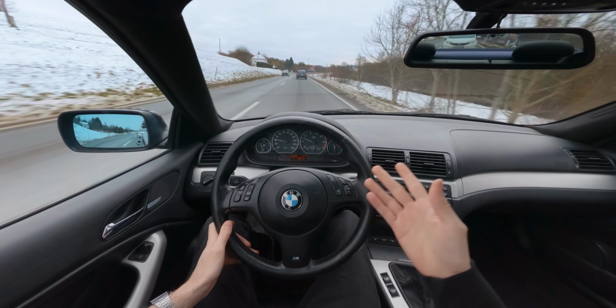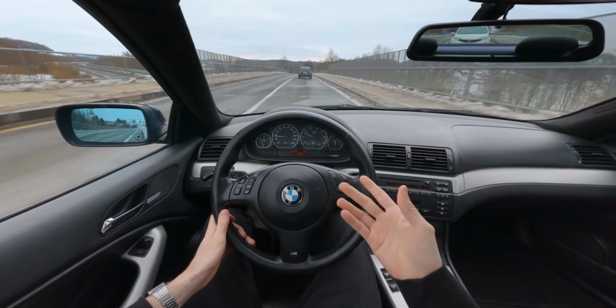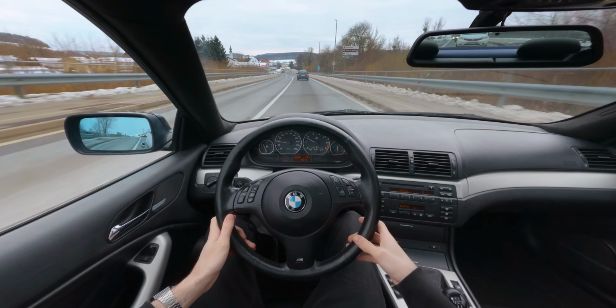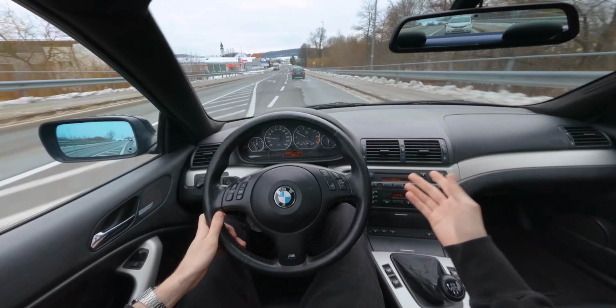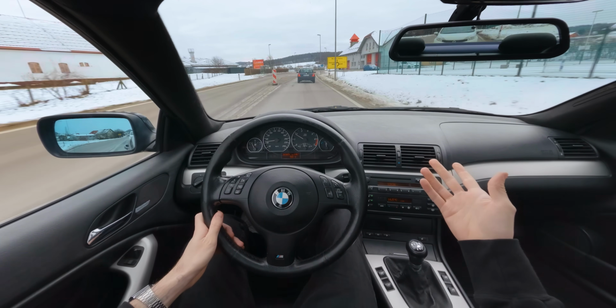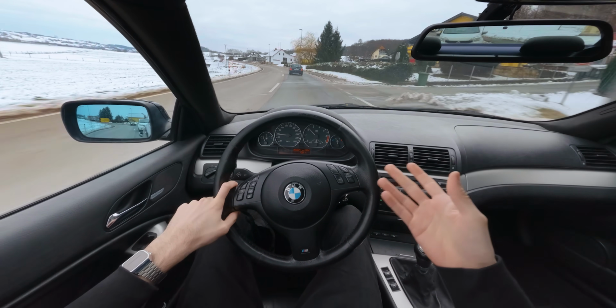And now for the engine and transmission mounts, that really depends on your layout. On a 3 or 4 cylinder, forget it, you'll feel every vibration. Inline 6, it works. V6, that can be a bit harsh. V8, that's more tolerable. And V10 or V12, you can basically go with solid here. Those engines are so smooth anyways.